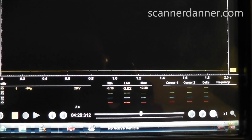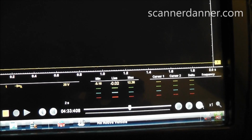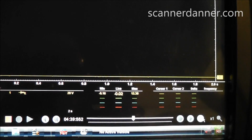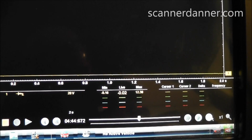Now, one of the things that you worry about is, are you even connected? Can we trust our voltmeter doing ground to ground voltage tests? Well, remember, the key is on, so it is a loaded circuit. That's critical. And then the other key with this would be to disconnect your lead from where you're connected.